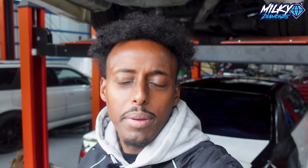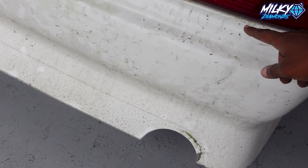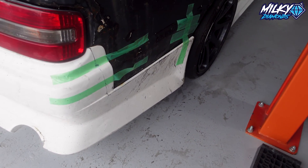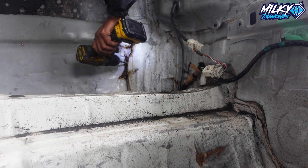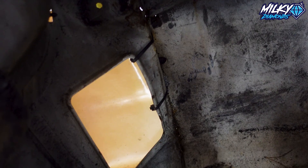So it's the next day and we're out here again at PV. We've done the side skirts yesterday and they are looking good. Today we've got to mount up the rear bumper, which actually has the broken mounting point, so I've got to figure something out for that. And then we're going to repair the front bumper and put that on. So I've temporarily managed to put the bumper on — there are little tabs underneath here, so I just slotted the bumper in there and taped it up just to test the fitment. I've just cable tied it because I'm probably going to hit my rear bumper, and if I cable tie it, the cable ties will break as opposed to if I bolt it with a nut — then the fiberglass will break.